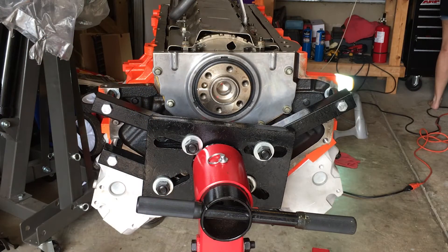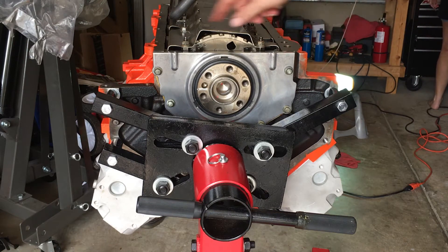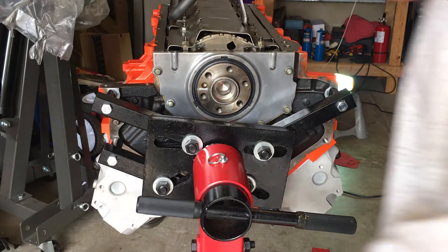Got the rear cover, checked the tolerances — I'm within .01 here and .01 here — and now it's time to do a little 18 foot-pounds.